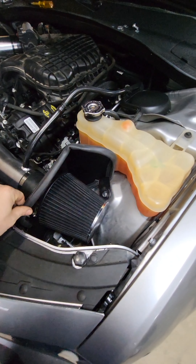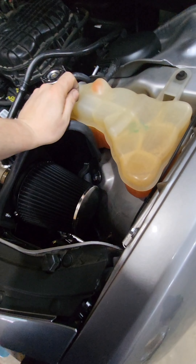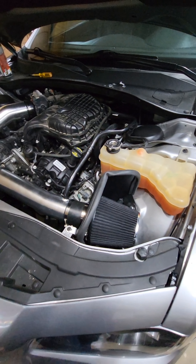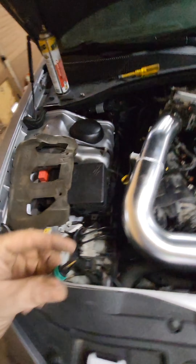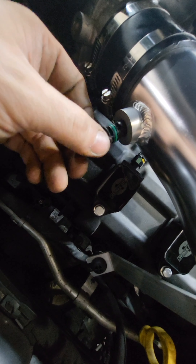Here's the final fitment. The top rubber is the right length to go around here. Looks nice. It has a little bit of play because of that rubber pushing in there. The vent is hooked up. I like it. It does come with extra hoses and bigger hoses of different sizes. The last thing I need to do is the mass airflow sensor — it should slide in here and twist.